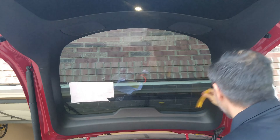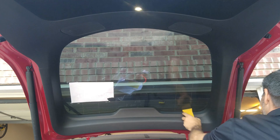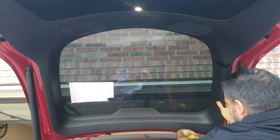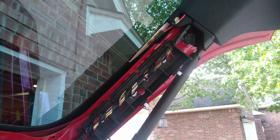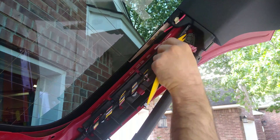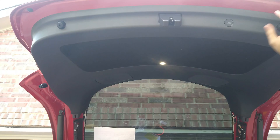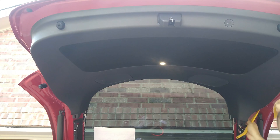Let's start by taking out some of these trim pieces here. Hopefully we can do it without damaging the glass. Before removing this piece right here, there are two clips. We'll take that one out and then we'll do the same on the other side. Now I can start working out this piece — let's be careful because there's a switch here, which means there's an electrical cable that probably doesn't take kindly to being overly stretched.